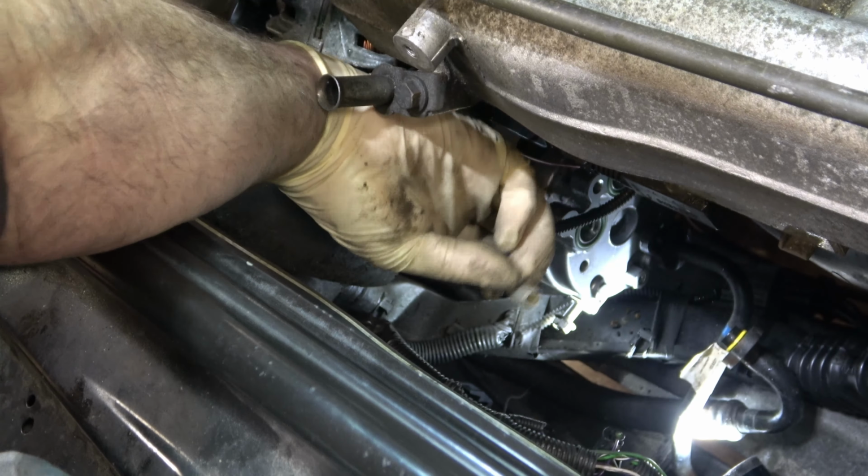All right, we're ready to reinstall all our stuff. I will wait to take off the fill valve here until after I've started the car and run it for a minute or two to make sure that everything equalized. But I can go ahead and put this on. And that's our low coolant warning light. We can take our little bolt that we kept everything from leaking with and stick that back in there. If you've lost any coolant, you can redo it. You top it off right now, but mine's clearly between the min and the max, so I'm happy with that. I'll go ahead and move my cabling over just a little bit so I don't catch anything. I'll put that back down in here and reattach that right there.